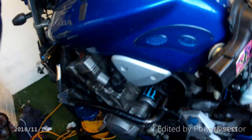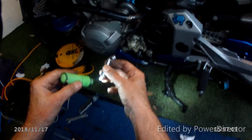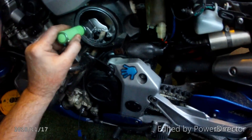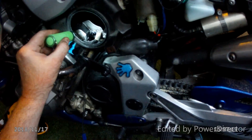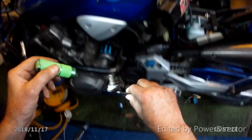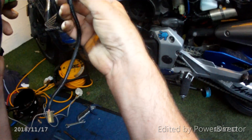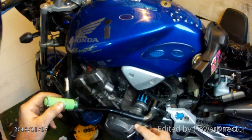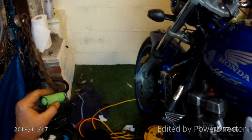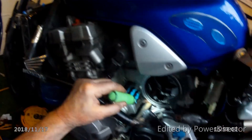It's a good job the time's obscured with that Power Director logo. Rather drastic, but I've had to extend the hole to get the bloody nut — it was skewwhiff on the nut and it wouldn't turn. I've looked and there'll be sufficient to hold it in place. What a mess, but it's finally come out — and look at that, soaking wet even though there's an O-ring. The bloody thing's soaking wet — is that why it's failed? No worm drive off the front wheel anymore, it's all electronic. So that goes in a hole and something whizzes round it and that picks up the revolution.